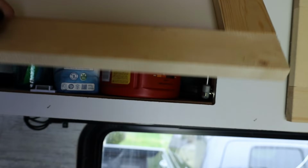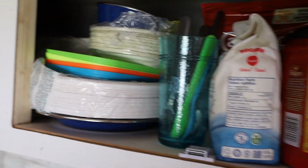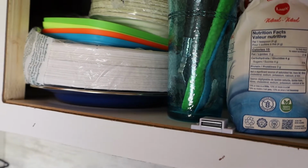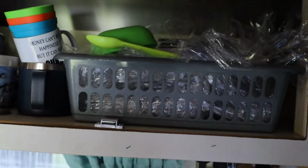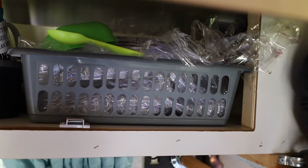Okay, cabinets. Just came back from camping, but all on gas struts and all lined. You can see I put this in the top too, so it's not sitting on these lights underneath. And for right now, this is free floating. Got a magnet here with a piece of metal right here. So when we close it, it just holds it shut while we're driving. Same thing with this one. Pull it up. And a gas strut on this side too. And there's no end in it. I just put a block over here, just to hold everything in.